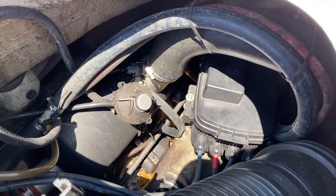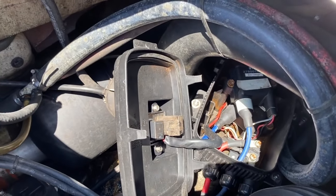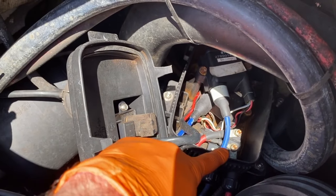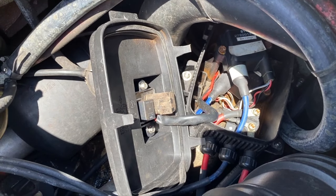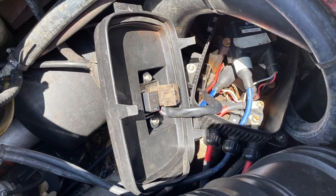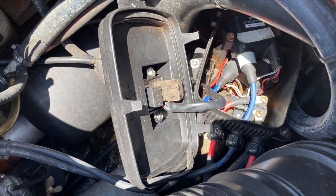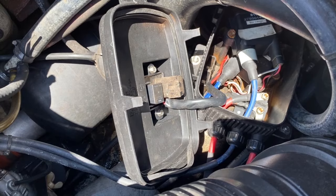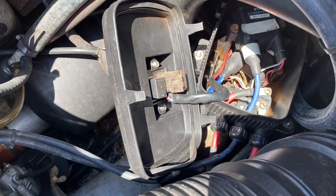Common cause number three: let's go back to the rear portion. Yours may be positioned in a different spot inside your hull, but that little electrical box right there — I've removed the cap and you can see some blue wires, red wires, and black wires. The two threaded studs with electrical wiring secured by nuts — that is our starter relay. If your starter relay fails, your engine will not start. Over time these relays begin weakening and performing intermittently — sometimes it lets you start the engine, and sometimes it doesn't.